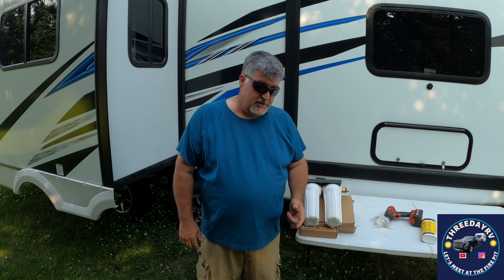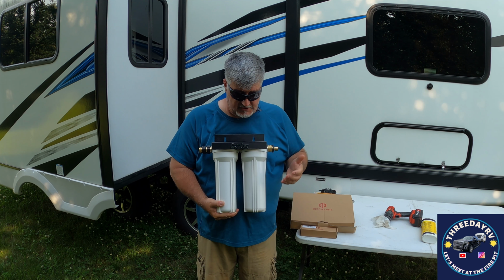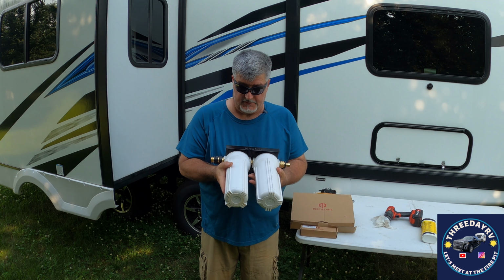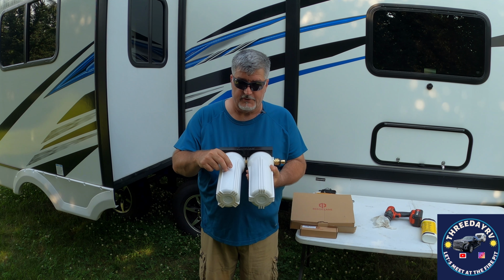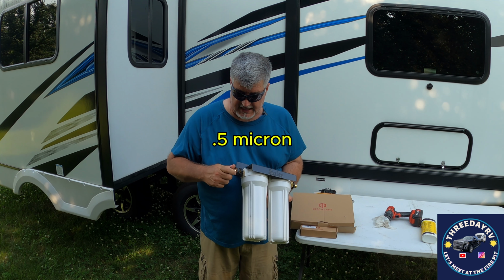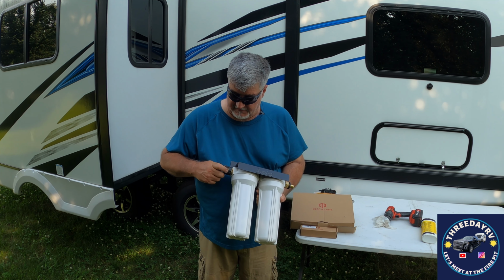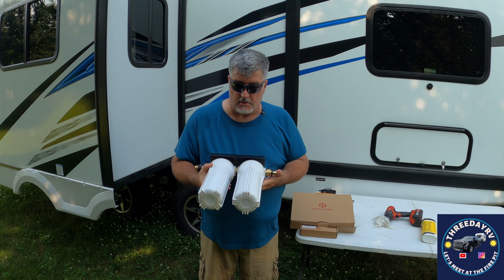It's time to go. First thing I'm going to start off with is this double filter system. I'll put the specs in the description about the micron size of this filter, but this is an inexpensive filter that is easy maintenance. These things spin off. You have a real fine filter and a particulate filter, and I happen to put on these quick connects that I got on Amazon. I'll also link those in the description so you can find these. These are terrific. So we're going to mount this on the camper and show you how we use this to help keep the clean water rolling into our camper.